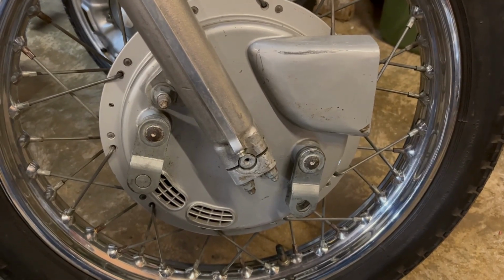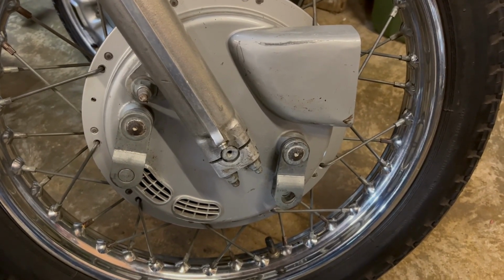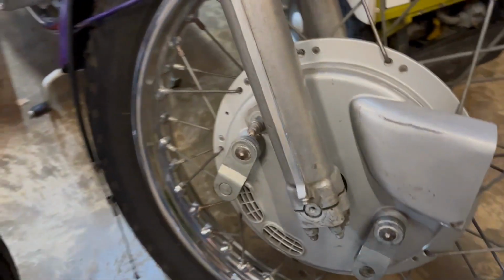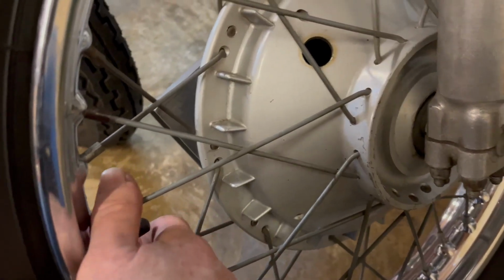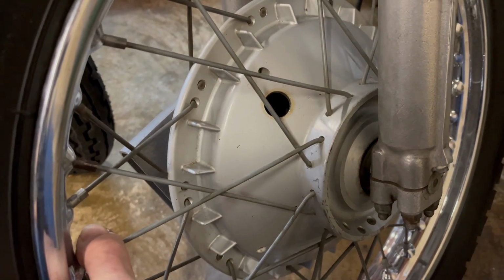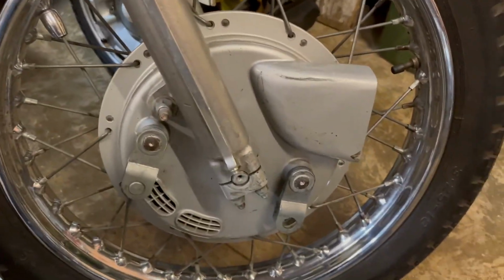Right, we're getting there. So just to explain, for those that haven't seen any previous videos on conical hubs, what you have to do with these is each of these cams are adjustable via a vernier, which you get to by taking a rubber plug out and positioning it in the right place opposite the cam, where you can see a screw adjuster which adjusts the verniers, so you can adjust the play and the distance of the shoes between the drum. So you back that off first. There's one on each cam, and then you can then remove the wheel and the drum quite easily.